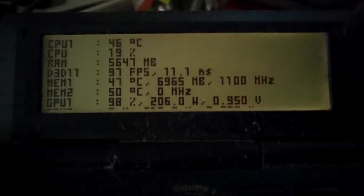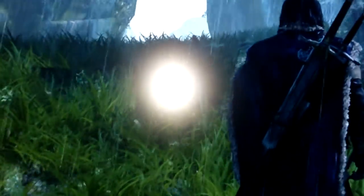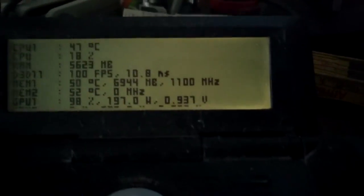We are at 200 watts per card. Let's check what my wall meter says - it says we are running at around 680-690 watts. As I said, I've got the cards undervolted so it runs at 0.95 volts at the moment whereas 1.2 volts is standard.